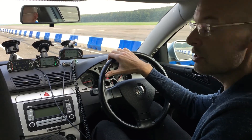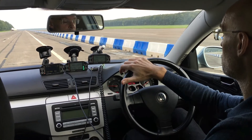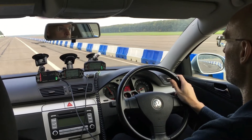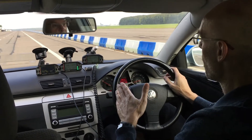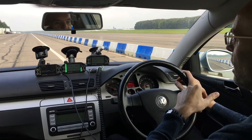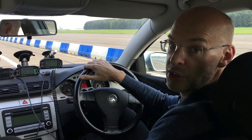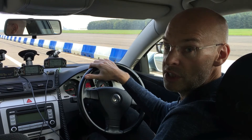I'm just going to drive down the track now so you can see the results as they come up on the screen. This is the way we normally do the testing. At Bruntingthorpe there are various white lines on the track and I like to line up the driver's wheel with the white line, which gives us an excellent guide. We're just going over the markers now — that's the first reflective marker and hopefully you can see the numbers increasing. Now we're going over the second reflective marker and it's stopped. That was a slow steady-state test. Normally we go over the first marker at constant speed and then apply full brakes so the ABS comes on, generating a full 1g deceleration as we cross the second marker.